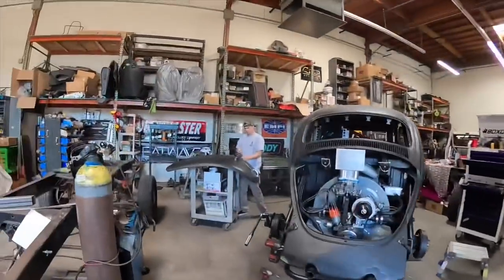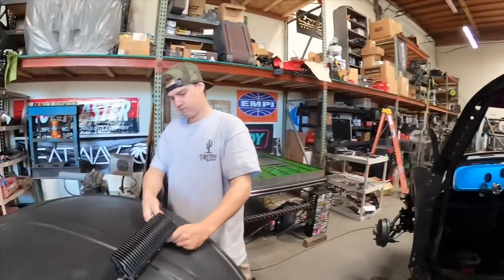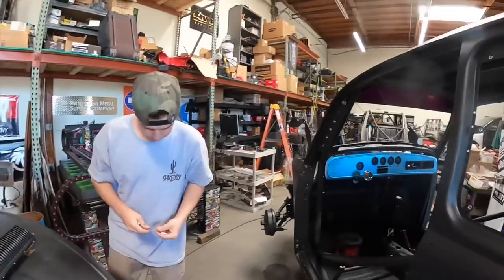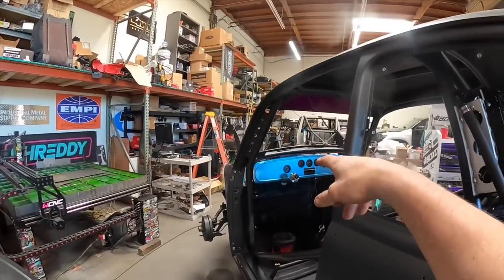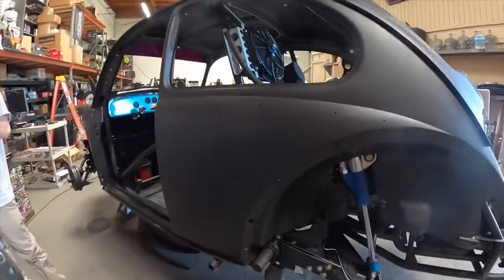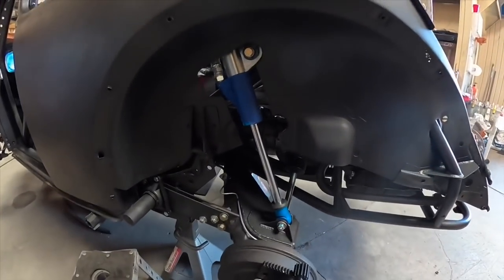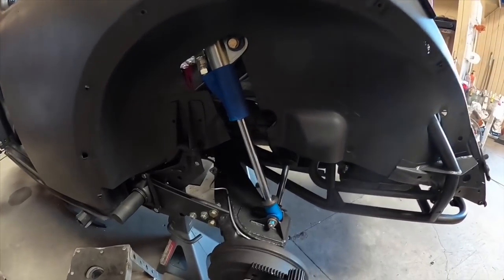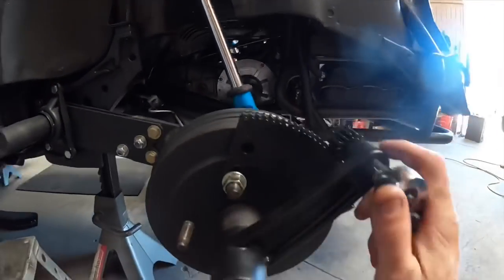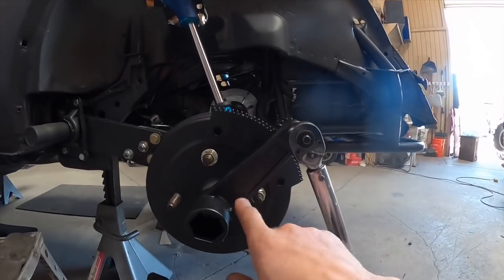Now I'm going to dive back into the shark. We're getting some more parts ready for powder coat, finishing outfitting the dash. Zach's pulling some light bar tabs off for our Rigid lights to get those powder coated as well. The dash is going to powder after I finish a couple more spots. Check this out — this is a torque multiplier. It has this gear drive and when you torque it down to 25 foot pounds, it outputs 225 foot pounds with this torque multiplier.